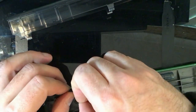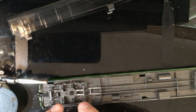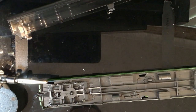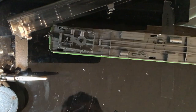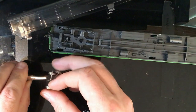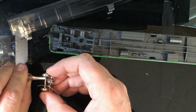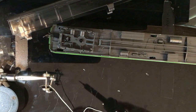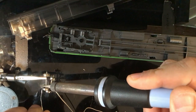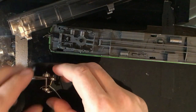This is an important part to keep in mind - this truck is polarized on the left side, and the other truck is polarized on the right-hand side. Don't get it mixed up because that'll be a dead short. We've tied that one off, so we'll just solder that one in - boom - and the same. That's pretty much it on the wheel pickup - that's how simple it is to get the wheel track power onto your trucks.